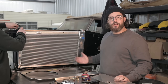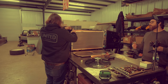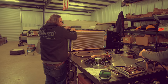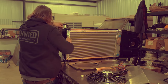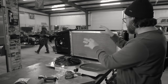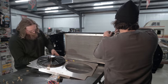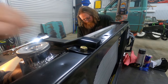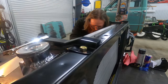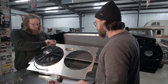This is our DIY cooling system for an LS swap C10. For mock-up, we're just going to show it to you with one fan here. Mike is getting that all bolted up and you can see we're basically just using our upper radiator mounts — they fit perfectly right here on the CJ Pony Parts radiator. This thing conveniently has all the holes already drilled for these fans. Vintage Motors provided the shroud and they went ahead and put the holes in, and they tell you exactly what fan to use.